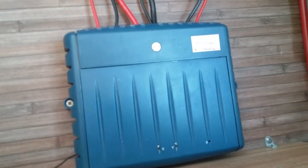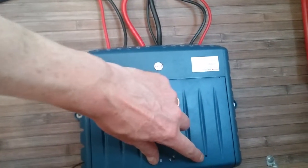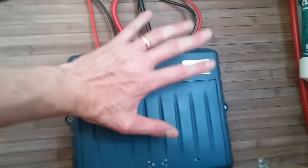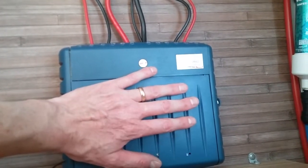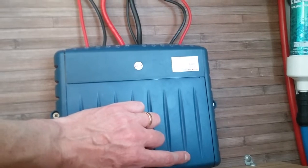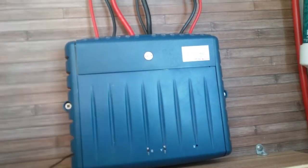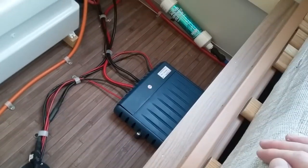And then we have the control board for the Power Touch motor mover. You'll see just here there is an R for reset. So if for any reason the unit is not communicating with the handset, you can reset it. Use something like a cocktail stick and push this in, and when you push the button in just here, lights will come on the control board. Once that happens, all you need to do is turn on the handset and it will then repair.